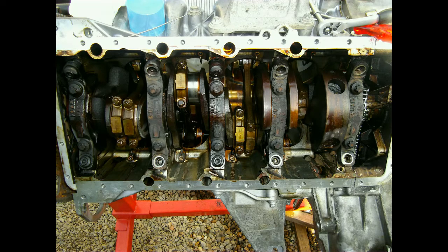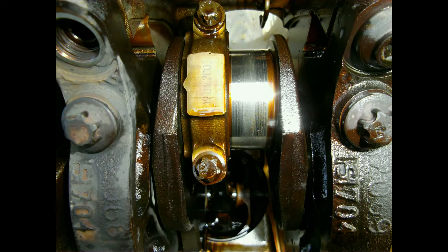It is time to concentrate on the engine block itself. In the beginning of this project I took one piston out to check the rings and the rod bearings. The crank does not look too bad — it is clear it suffered from oil starvation but the grooves in it are not deep. I can barely feel them with my nail, so a good polish up will do, at least. That's what I hope for. Of course it all depends on what condition the rest of them will be.